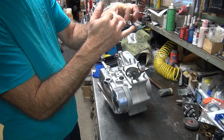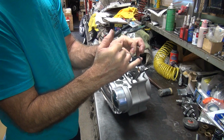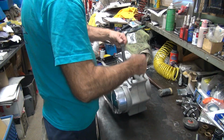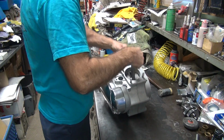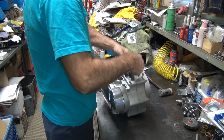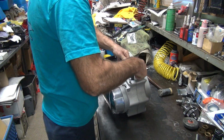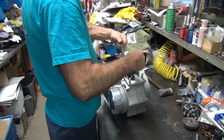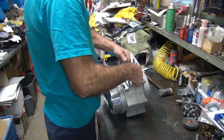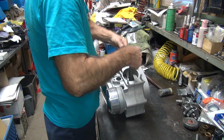So now with the thrust washer dropped down like this, so it's cocked sideways, and you're hearing a cam rubbing hard right in this one spot. So I pulled it back up, so now it's just hanging lightly. It's a lot freer. So you're probably moving the engine at just past idle speed right now. It's still not free enough to come up, but it's working. Is that about how fast it would be idling? Probably faster than that. Like 2,500. How many beats per minute am I doing? I don't know. Probably like 600.